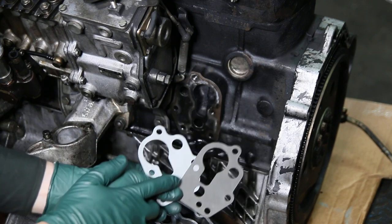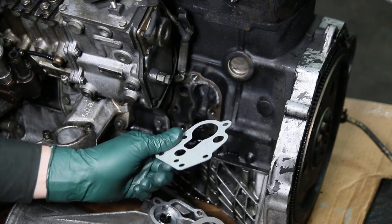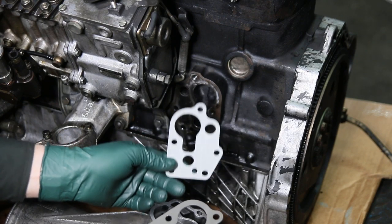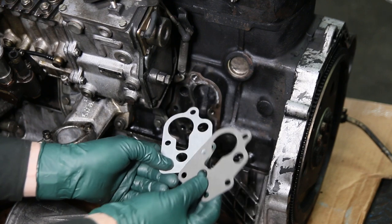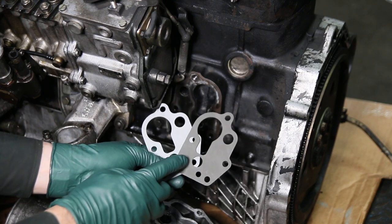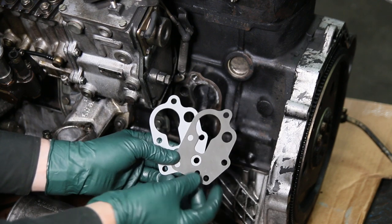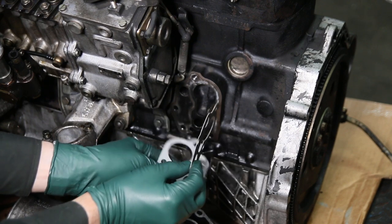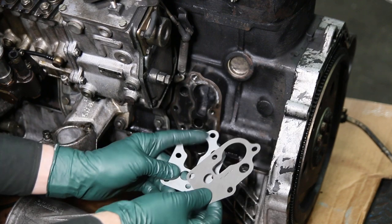You can see here I'm holding two types of gaskets. This is just your normal paper gasket, and these are the gaskets that are showing up in most of the overhaul gasket kits for these engines. This here is an OE gasket — it's called a waffle gasket, and if you look at it closely it's got a little waffle pattern in it. It also has metal in between the two halves of the gasket material.